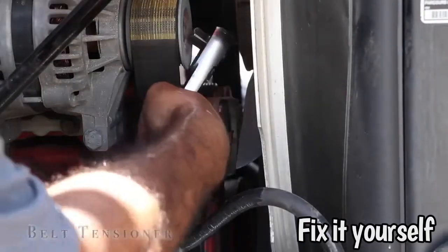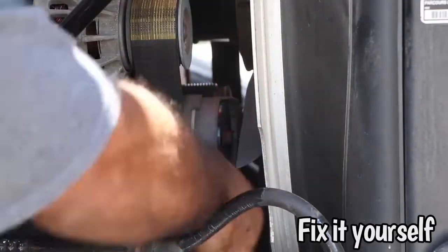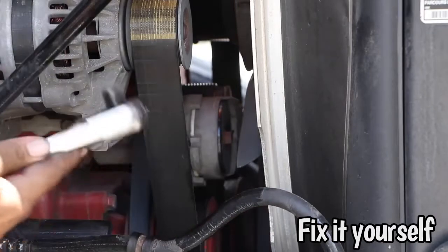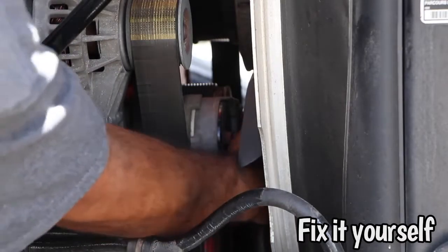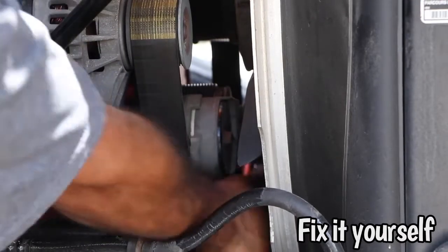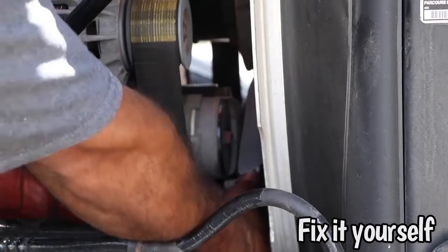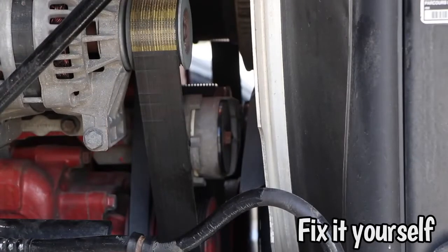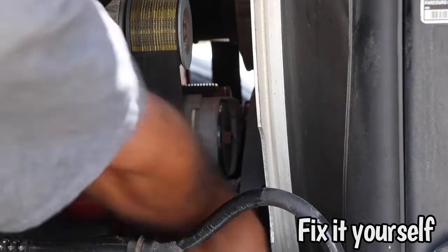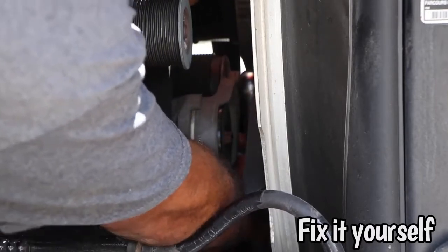This is your tensioner. I have to use a ratchet — just the ratchet itself — and I have to move the fan, which I already did. Sometimes your ratchet piece, you might have to turn it to get it lined up with the hole. Once you do that, you press the button. Now the belt can come right off. But you got to keep in mind, if you don't know the pattern of the belt, you need to take a picture. That way you can put the belt back on the way it came off. You do the same thing with the tensioner. I'm going to take the belt off and lap it right there. Done deal.